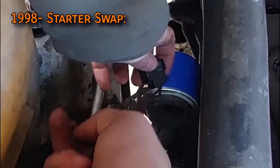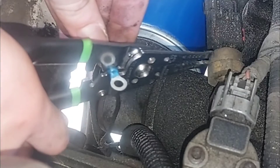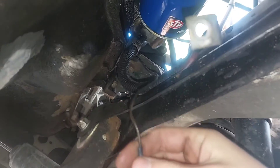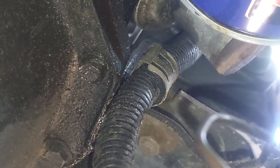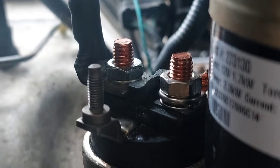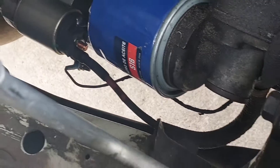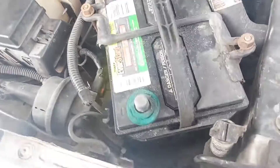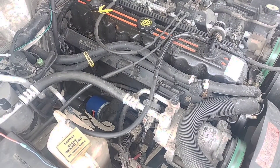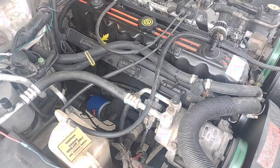If you're using a '99-plus starter in a '99-plus Jeep, you'll just plug in the connector like normal, but to swap in a '98-or-prior starter, cut off the old connector, strip the insulation, install a ring terminal, and put that on the stud. With the ring terminal heat-shrunk and crimped on, it's easier to do this from the underside. Then the feed wire has a locking washer — snug that down, and with a visual confirmation that no wires are touching anything they shouldn't be, reconnect the battery. Now the only thing left to do is try to start it. And now the moment of truth.